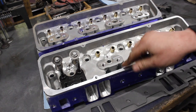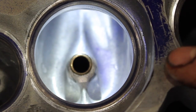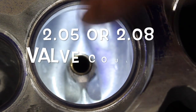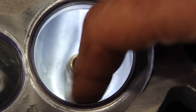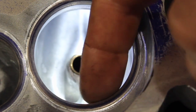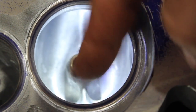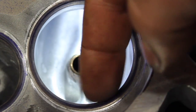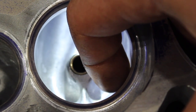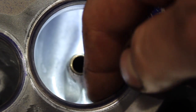So let's go over the first thing I did to these heads and what the flow difference is. Step one is basically just cleanup. You'll notice that these heads are almost screaming for larger valves as far as the valve seat versus the bowl throat area. What you'll want to do — and what I did here — is take a carbide and actually blend the seat into the actual head, into the aluminum. The insert is actually going to be smaller than the aluminum head, so you're going to blend that in all the way around and taper that seat so it blends with the aluminum and takes away that ridge. Be really careful you don't nick your seat too much — take your time and be really gentle.